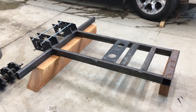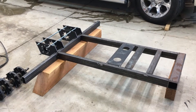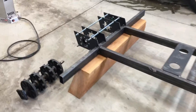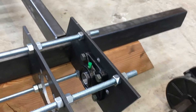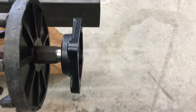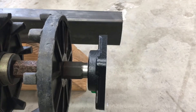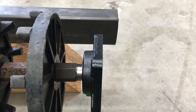Today is another day working on the mini snowcat. Some more parts came in — the front one inch flange bearings that will hold the track drive shafts. Now that I have these I'll be able to get the drive shafts mounted. This side I'm going to have to build a small arm that extends out from that piece of tubing just to support this side of the drive shaft. I have an idea and hopefully it's going to work out so I can bolt that little arm in place.